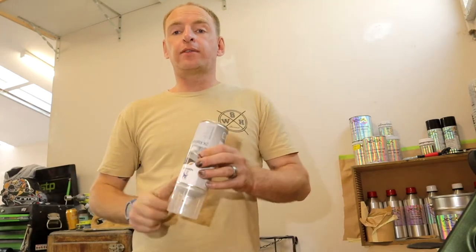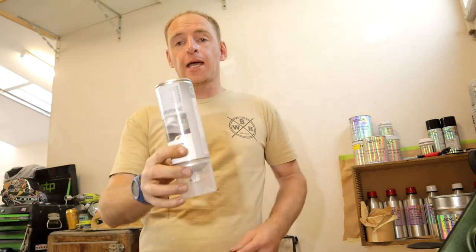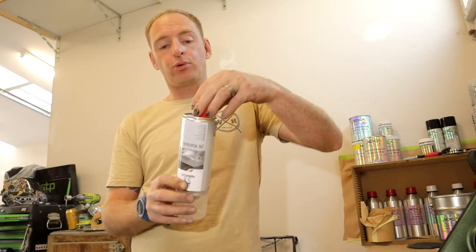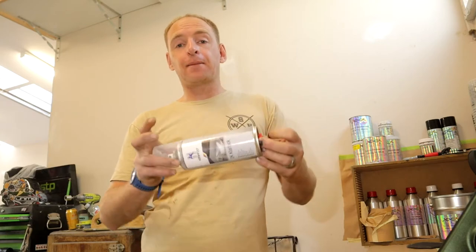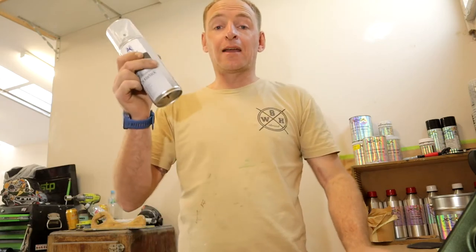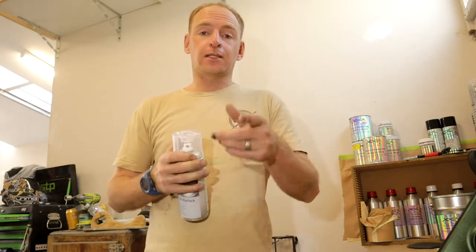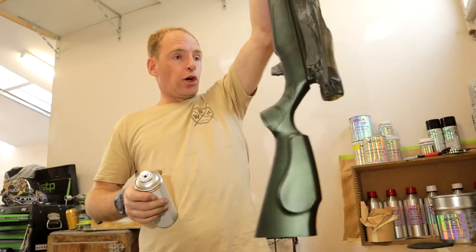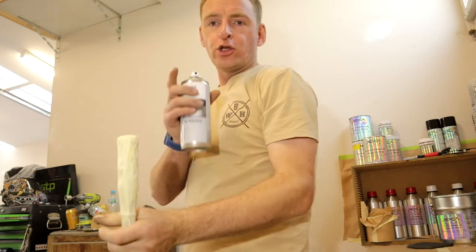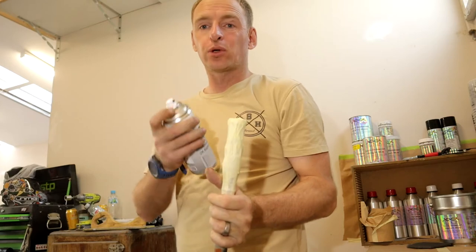What I've done with the NormFest clear — as the directions indicate, you put the can upside down after shaking it for two minutes. You grab the red cap, put it on the button, and activate it. Once it's finished activating, flip the can back up and shake it for another two minutes, which I've just finished doing. Let's take the lid off and start applying it. You don't actually see the true form of the colour until you've got the clear on, so let's put it on now.